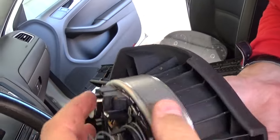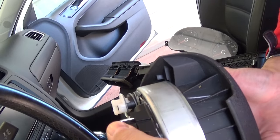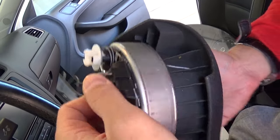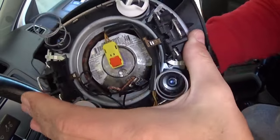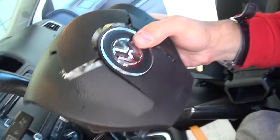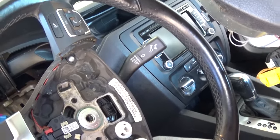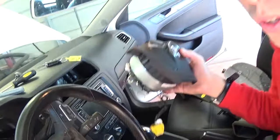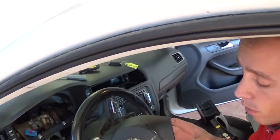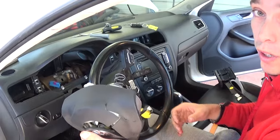That's the airbag right here. Those are the two things that you need to push in with the screwdriver — grab them and push them like that. It's really, really spring-loaded, so it's not easy. You need the right screwdriver to do that, otherwise you have to remove the cluster, which is not very hard — it's on our channel if you need to see. Thank you guys for watching, subscribe, more videos coming soon.